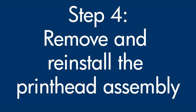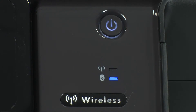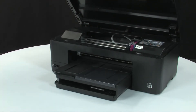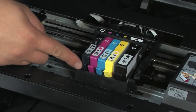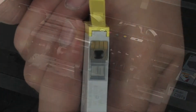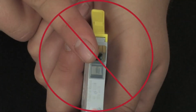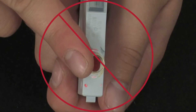Sometimes, improper installation or placement of the cartridges or print head assembly can cause a carriage jam. The printer must still be on for these steps. Open the top cover to expose the carriage; if it moves to the center, allow it. On the front of the cartridge, push the release tab inward to unlatch and remove the cartridge from the carriage. Repeat for all cartridges. When removing the cartridges, be aware of the electrical contacts and ink ports — do not touch them, as this can cause clogs, ink failure, and poor electrical connections.